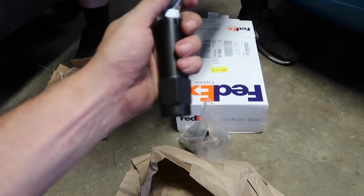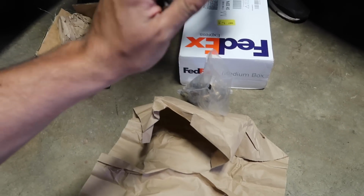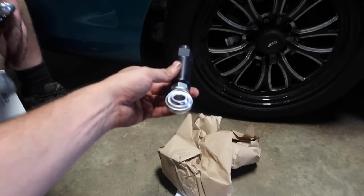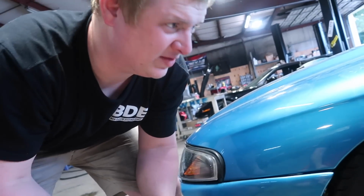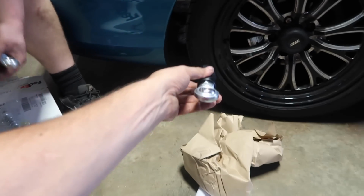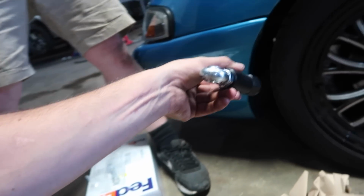Yeah. That is nice. That really is nice. 281 Himes. They're fat too. I mean, that's a pretty good unit. So what this does is, as you lower the car, the steering rack obviously is on the K-member, but are they the steering arms? What are they? The rack ends. Yeah, the inner tie rods. The inner tie rods, they start going up because everything is getting shoved up in the car, so they sit at an angle like this, which makes it very unsafe.